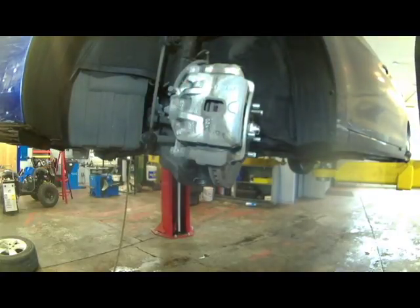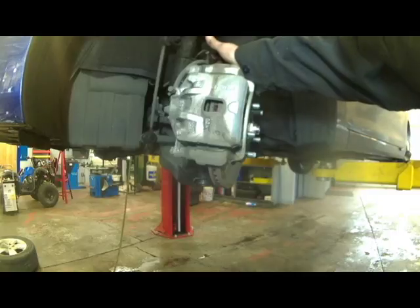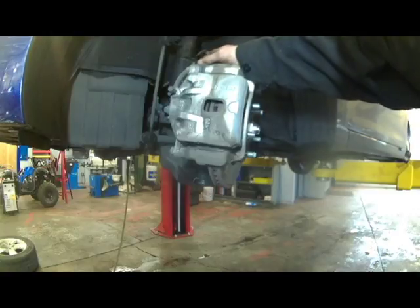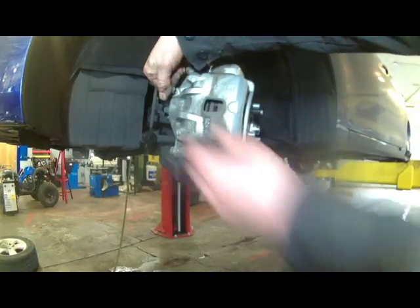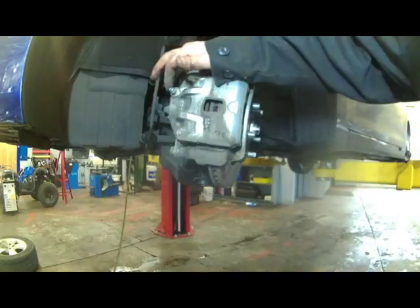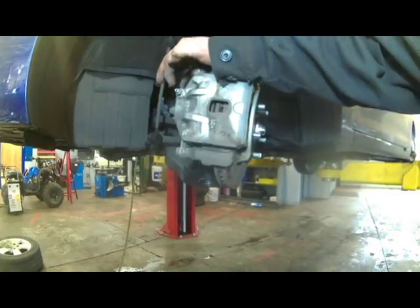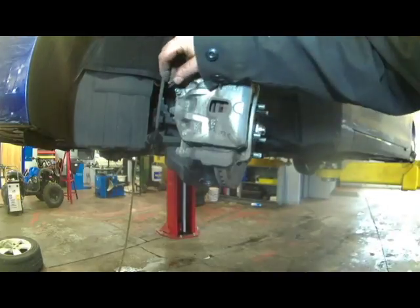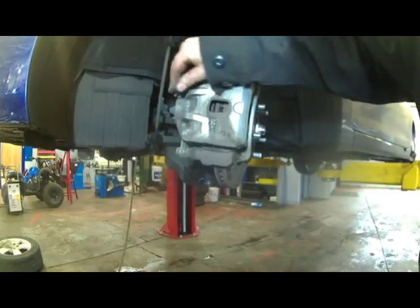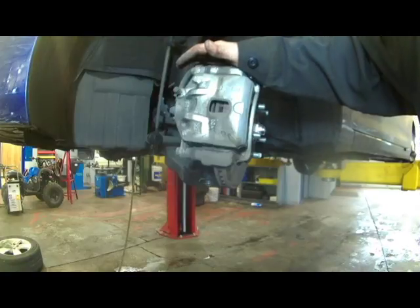We'll talk about the master cylinder. When we collapse the piston, it's gonna force fluid up through the hydraulics back to the master cylinder. We don't really want to overflow that, so I've used a clean rag in the past, or a turkey baster, or a suction device of some kind to suck out some fluid. Or you can take this bleeder screw. It's probably a 10 millimeter. Just turn that until it opens up, and let some fluid out for a little while, and then close it. You don't want to suck any air through there, but just opening it up and letting it run out should be just fine. But we just collapsed it, pushed the fluid up. We'll just make sure the fluid level doesn't overflow. Just not good for the paint.